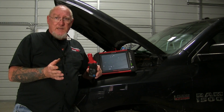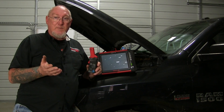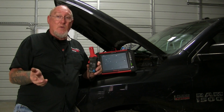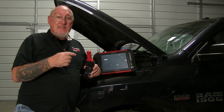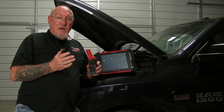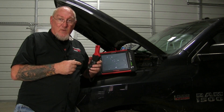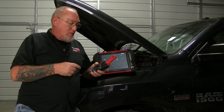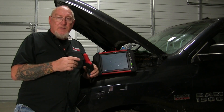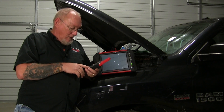I'm all about doing everything as easy as we can, so if I want to measure current in a circuit, the first place I'm going to look for a possible connection point is the fuse box. If I can access that circuit independently there, I can get as clean a measurement as if I go diving into the engine compartment trying to get right around the wire at that component. Play it smart, take time to look at the schematics to see where's the best place to connect, and we'll get into that more as we go along.